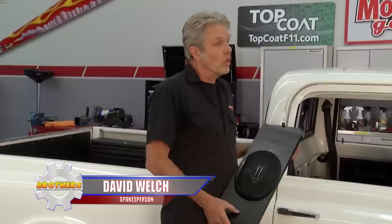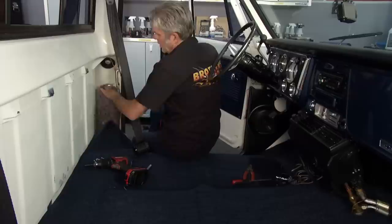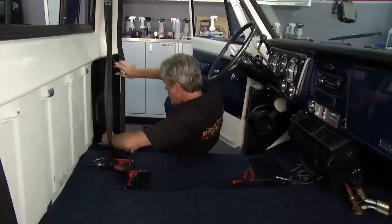We're going to go from one to four speakers — putting them in each corner using kick panels specifically designed to go into the corners. For the first step, we did a little recycling — we took the old jute and stuffed it in the corner so all the noise goes forward and doesn't give any reverberation into the metal. You don't want to hear that rattle going down the street. Make sure you're not using the shiny side of the jute because if it makes contact it's going to blow out the speaker. Tape the wires down to the corner as well — it makes it easier to grab them and work ahead.